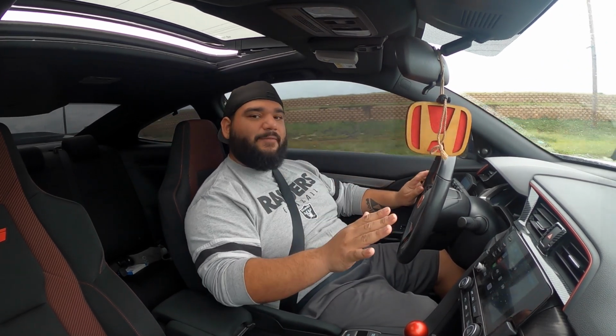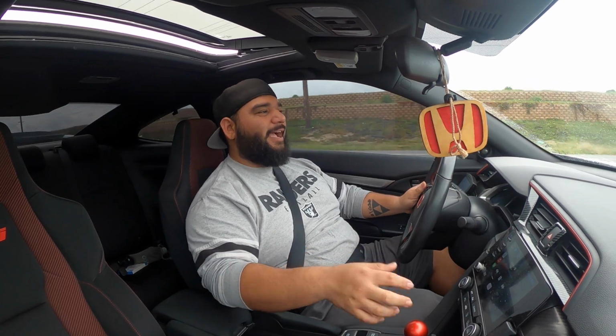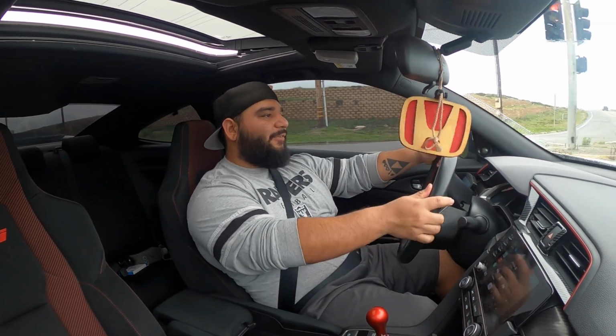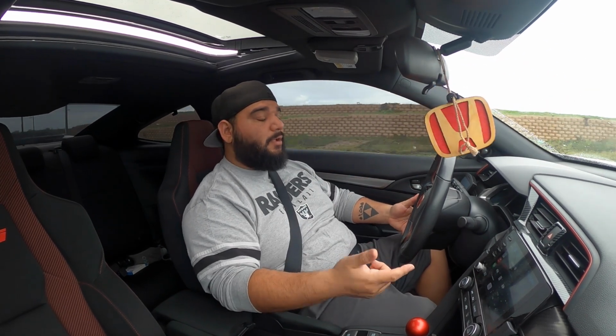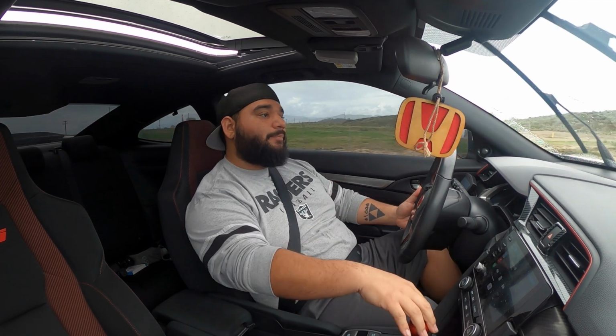It's a huge relief with it, and with knock control, I'm not gonna say it's non-existent, but I've never seen it go up more than like 0.52. When I was doing those friendly runs with Joe, it never got higher than 0.49. And that's also the nice thing too about doing this custom flex fuel e-tune. When I got my e-tune done, I first got tuned on 91, straight 91, not even a splash of 85, no nothing, just a straight 91.